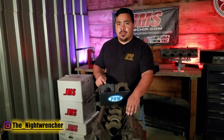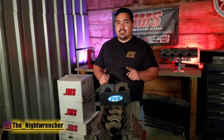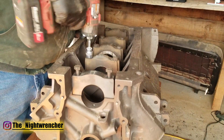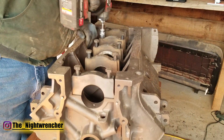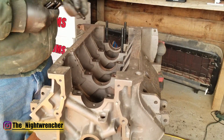So you've just received your engine block back from the machine shop — it's been line bored, it's been honed, it's ready to go. But there's still one step that needs to be addressed before it goes to the machine shop: upgrading the hardware going into the main caps. When you initially take the engine block to the machine shop, it has to be sent in with the correct caps in the correct order, and the hardware that's going to be installed has to be the final hardware you're going to use when the engine is fully assembled. When the main caps are torqued down, the engine will actually distort a little bit, and how much depends on how much torque you apply to the fasteners. Whatever hardware goes to the machine shop, that's the hardware you're going to have to run.